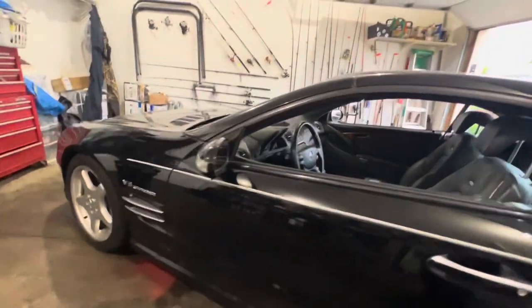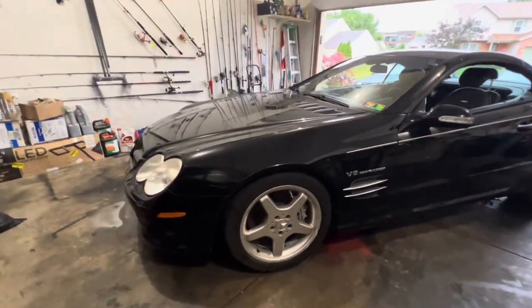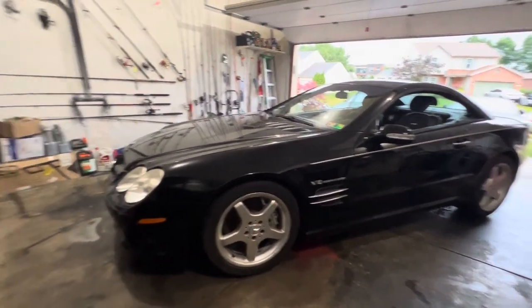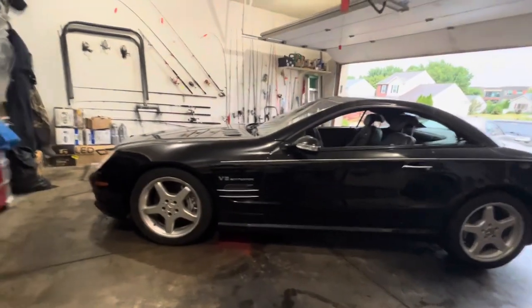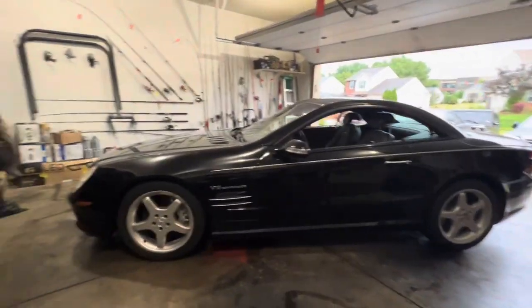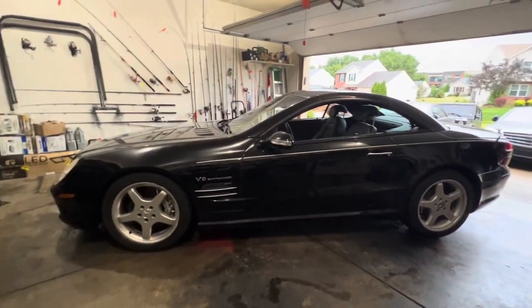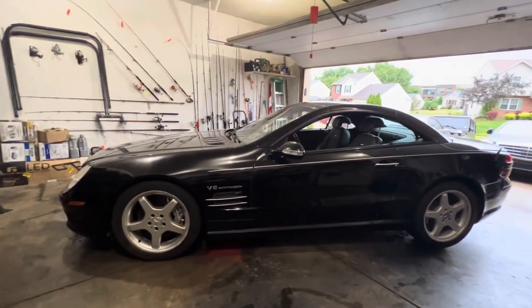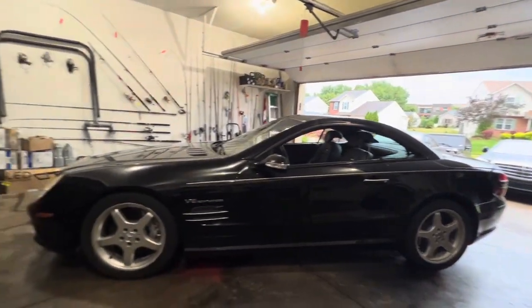And removing the problematic ABC suspension is the beginning of it. It now has a standard power steering pump. It now has coilovers all the way around. And now I'm at the point where I just have to adjust it to make it just right. Right now I have the rear set at 18 turns and the front at 24 turns. And that's usually where I keep them, something like that. Nice balance of firm and comfort. I gotta get the height adjusted properly, and then we'll see what we have.